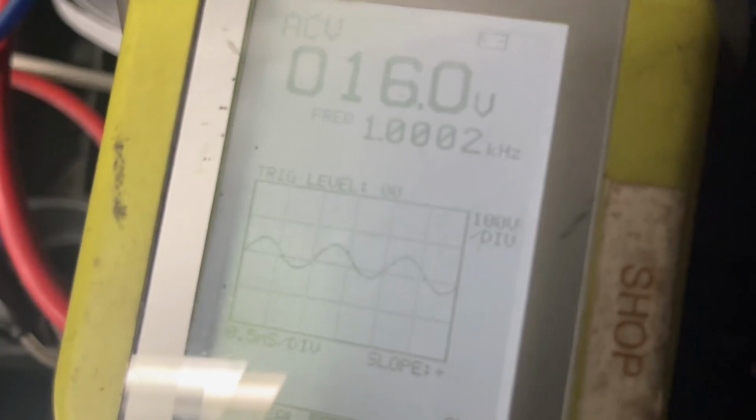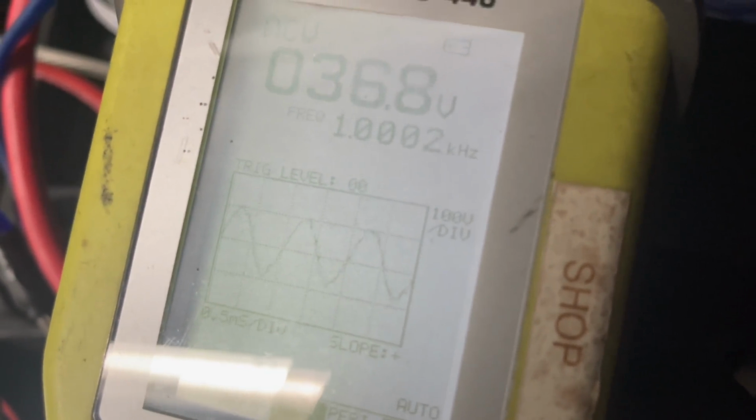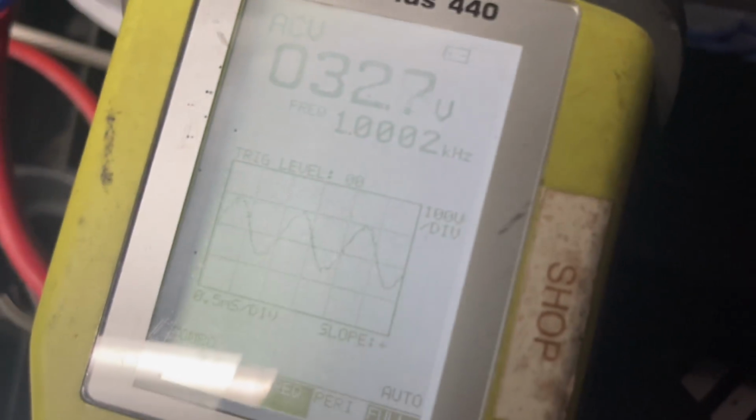I'm really surprised. The clip indicator on the amplifier works really well. We're feeding a 1000 hertz tone. We have the amplifier bridged. We're driving one channel. Clip indicators lit up. The line's looking kind of jagged. We'll back down. Clip indicators out. And there we are, 31 volts. Pretty smooth sine wave. No clip indicator.